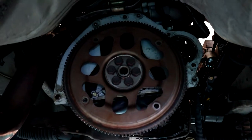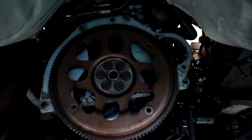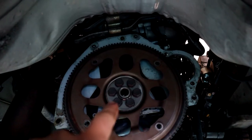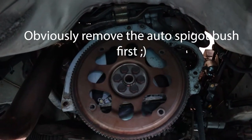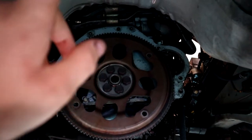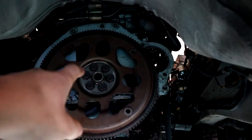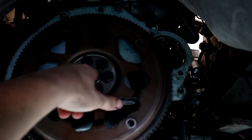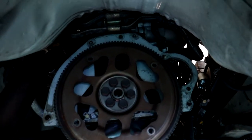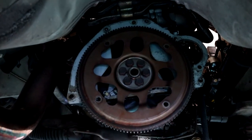And I will mention this at the end of this video if for whatever reason you decide to stop watching now. When you get to this point, get your new spigot bearing and put it in. You do not want to forget that, otherwise you won't be able to select any gears. Make sure you do that. If you forget that, it's your own fault because I've warned you. But I will remind everyone in the next video, but put your spigot bearing in right now. Make sure you do it.